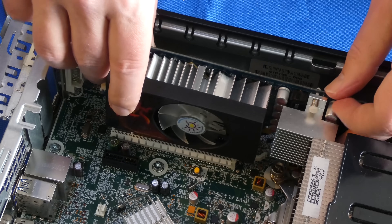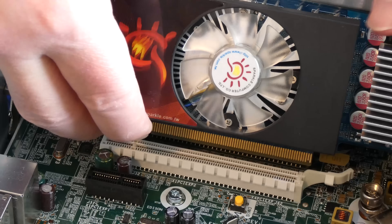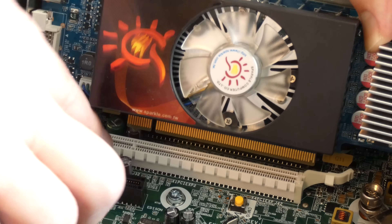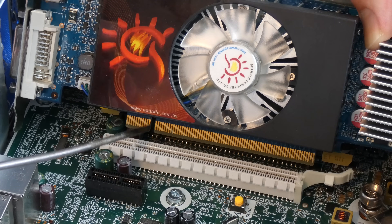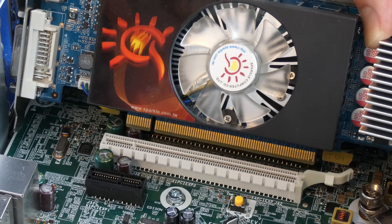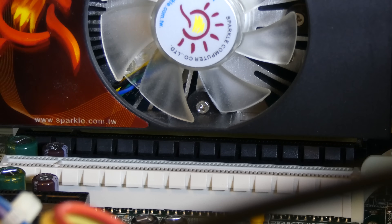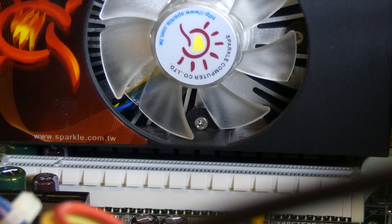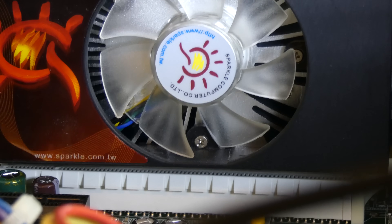Then we're going to insert our video card. Just be careful — don't force or rush anything. You see how this aligns? You see these notches on the connector down here? How they align with this wide slot? Make sure the notch is aligned properly. So as long as this notch is aligned, then we're good to go. We're going to do it on the back slot because we don't have enough space on the front one. Make sure everything is aligned, let the card drop into the slot, and once you know it's aligned perfectly, just give it a little push down until it's fully seated.